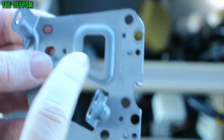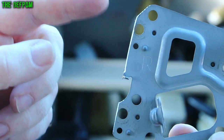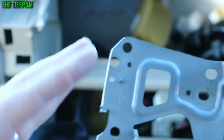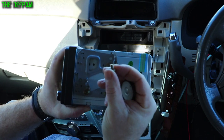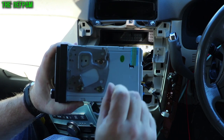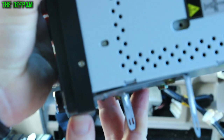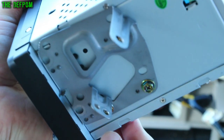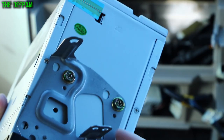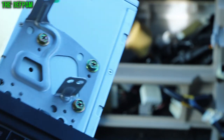The bracket has a left marking and the other has a right marking, as they normally are. I trimmed the front edge off — the two original holes are still there so if you need to use the bracket on the original stereo in the future, you still can. It's fitted with three screws which are actually proper threaded bolts, not just self-tapping screws — quite nice. The bracket doesn't sit perfectly flush because of the locating dimples, but I'm not worried about it. When doing up the screws, make sure you do them up pretty tight or vibration will make them come loose.